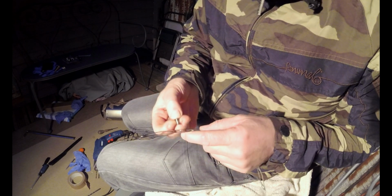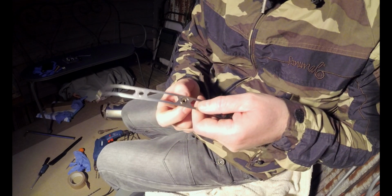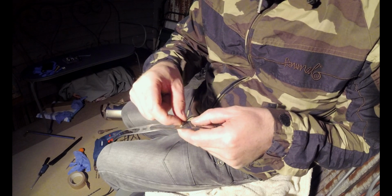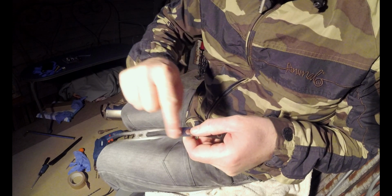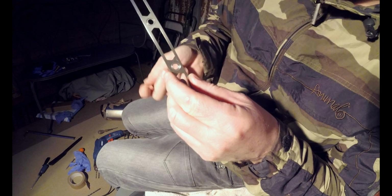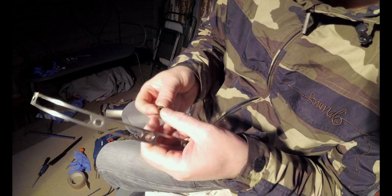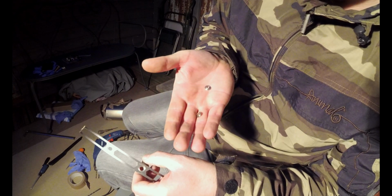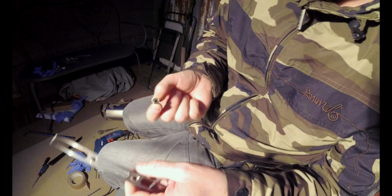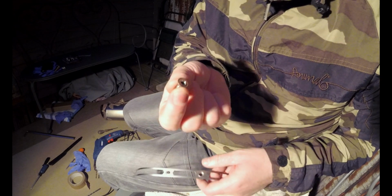And what happens is, they release underneath and they just spin around, and you're at risk of wearing away the steel as they turn, and the drill just holds on to it and it goes round and round and round, and it actually doesn't drill through. So probably half of them the head came off, which is what you want, and then this carcass, the plug, falls through into the inside of the exhaust. You don't want that, because that's what took me ages.